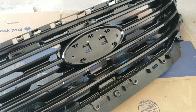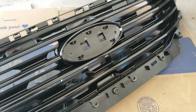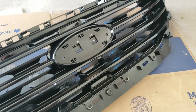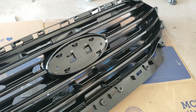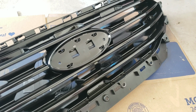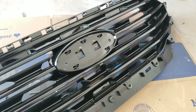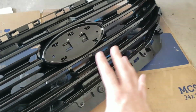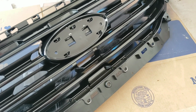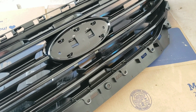Now, again, like I said, I wet sanded all the chrome first because paint has a tendency not to stick to chrome very well. All my sandpaper is not in a package anymore, it's just laying free, so I'm not sure what grain it was, but it's either 1,000 or 1,200 grain sandpaper, and you just get it wet, or you get the item wet. So I got all the chrome wet and then just sanded it down. That way you don't get real deep grooves or anything like that. It just scuffs it up real nice.